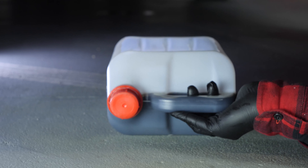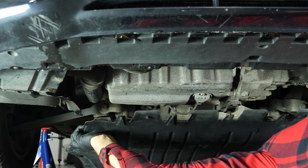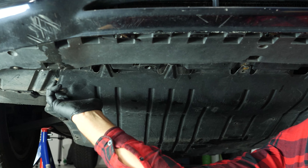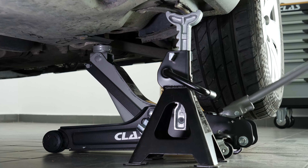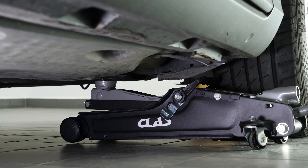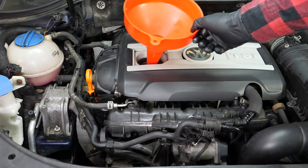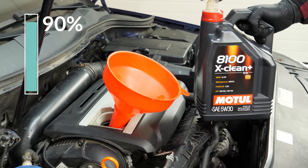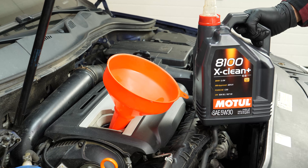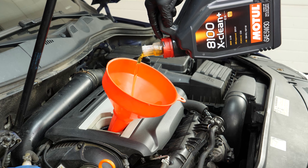Remove the liquid collector. Now you have to put the oil back into the motor — be very careful and precise when doing this part of the job. Put the crankcase back in place, then lower your car back to the ground and check the oil level; this can only be done when the vehicle is flat. Add the oil into the engine, beginning with 90% of the suggested amount — this will leave you a large enough margin to adjust the level appropriately. You can find the exact amount of oil suggested for your car in the description of the tutorial.